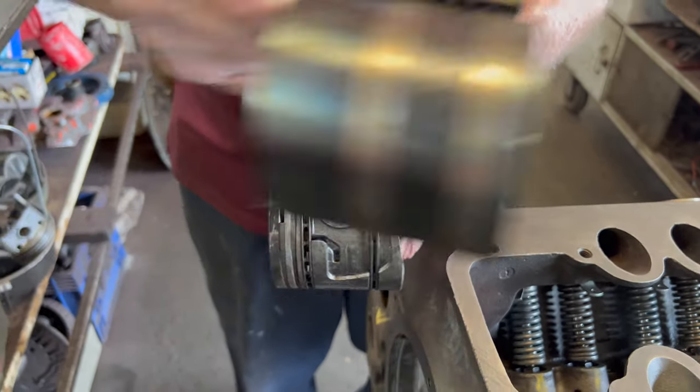When we grind the valves, I put the motor on a stand on a bench and set it up straight up and down. I put dye on the whole motor before I ground it — with the pistons not yet in — so I can see where I've ground the seat. This motor here is a 239. Then we have some tools.